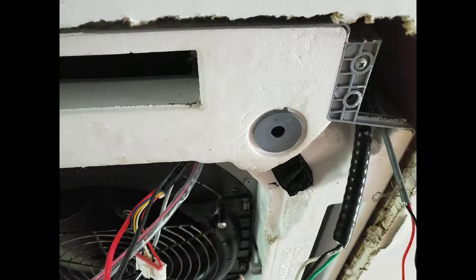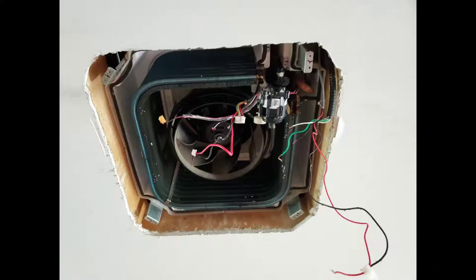The next slide has the drain plug, and this plug right here is connected to the drain pan. If you take the plug off, you'll be able to suck the water out of the drain pan — something you have to do before you take that drain pan down. The drain pan has four screws, one at each corner. You can take those off quick with a Phillips, and once that's done you've got your motor accessible.